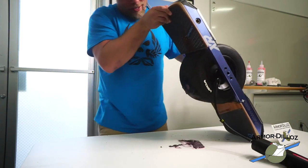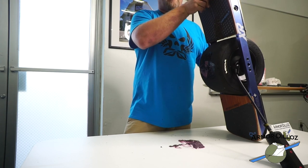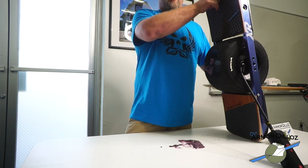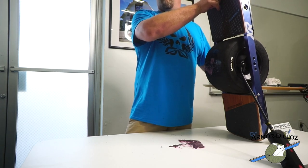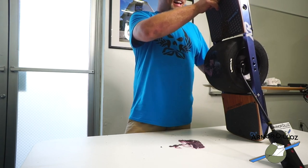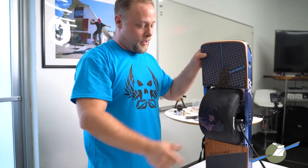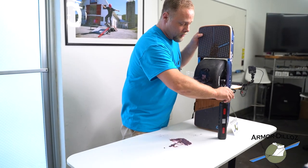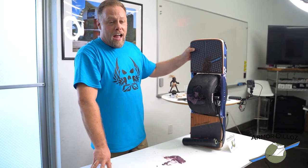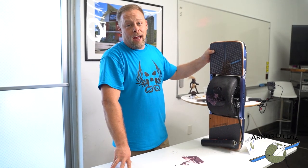Yeah. So, guys, no 3/4 inch holes. I think this pretty much conclusively proves it. 3/4 inch hole will not seal with Dillo. 1/2 inch? Yes, it will. So again, not magic. This is science, guys. There are limits to what we do, but the limits are extreme, truly extreme. That 3/4 inch hole held to 11 PSI. This tire is, you know, done. We can just see it is completely, totally done. But we actually were holding up to 11 PSI, even with this relatively crazy puncture. 1/2 inch, well, it wouldn't have just gotten us home. Frankly, we probably could have rode this tire for the next month with that 1/2 inch puncture in it.